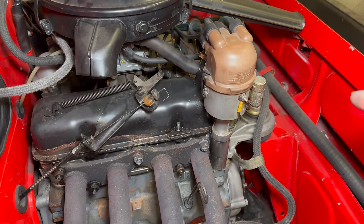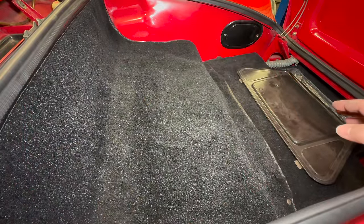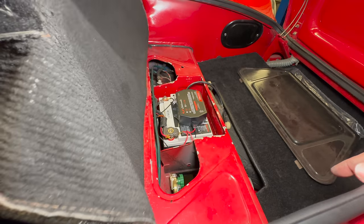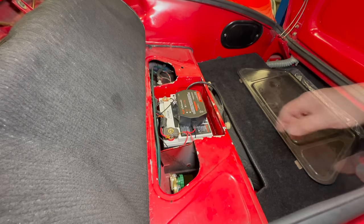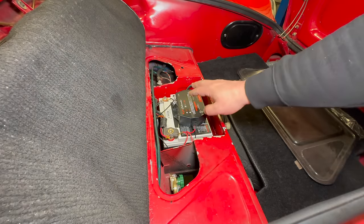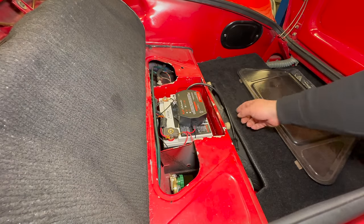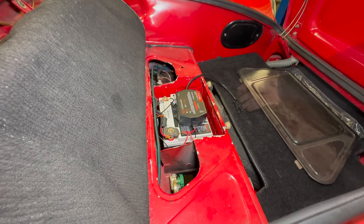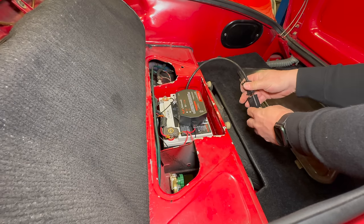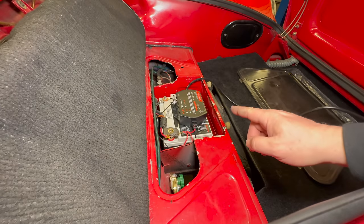Let's move on to the charging system. If you've been watching my channel you know that I hate batteries, and the battery on this car was no good anymore, so I have already replaced it with an ultra cap. Here is the same XS Batteries ultra capacitor that I normally use, as well as an onboard battery charger. The cord can stick out of the cover so that when I store the car I can just plug it into an extension cord. The charger turns on and keeps the ultra cap charged up.